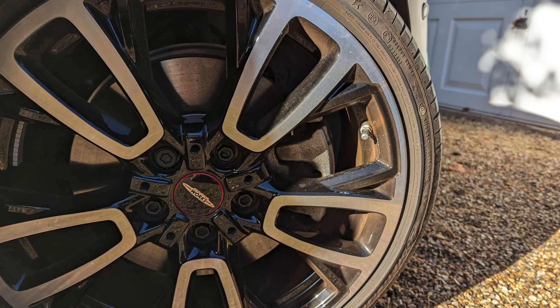These are the results I've got on the roof. Bearing in mind this is four passes of S20 Black — night and day difference. This is part of the reason I'd never get a black car, because this happens a lot. You really see any marks. I had a black car in the past, never going again. Now we're looking at the gloss black pillars — these are plastic, not metal. I'm giving it a go with S20 Black on the force rotation with the Rupes yellow pad, same combination. But you can see the results are hazy, so I'm going to have to try something different. There's a bit of micro-marring on the plastic, so I'll come back with the 3-inch pad on that later.